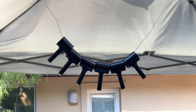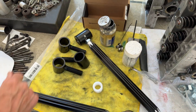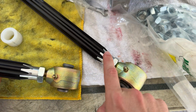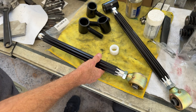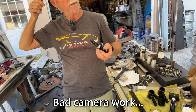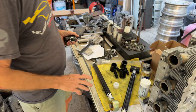With them painted, there was only one thing left to do — assemble. This one's done: grease fitting is in, the spherical joint is in, and this is the left-hand threaded one — the groove on this indicates left-hand thread. The way you put them on the car, you turn both the same direction to increase or decrease your camber. So laying under the car, you push the wrench to the front or to the rear — same direction on both — to widen or shorten the track for more negative or more positive camber.